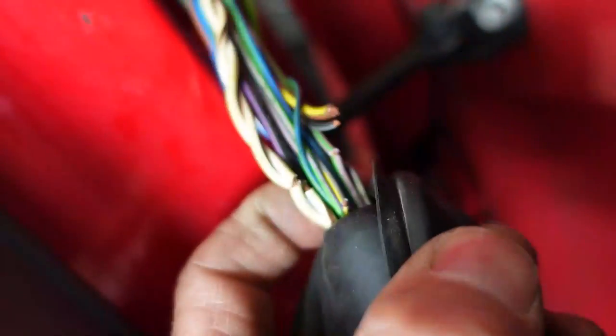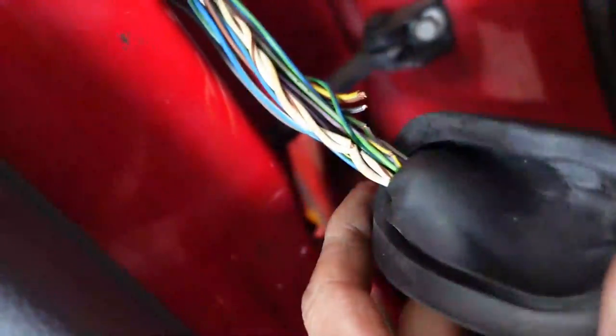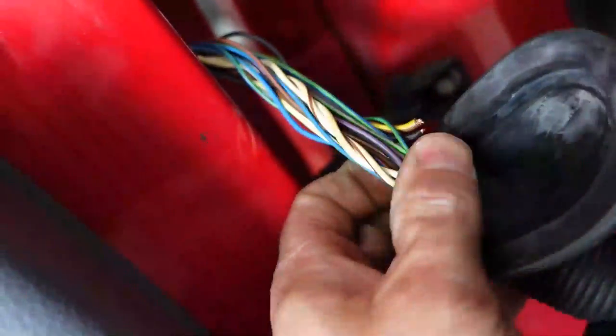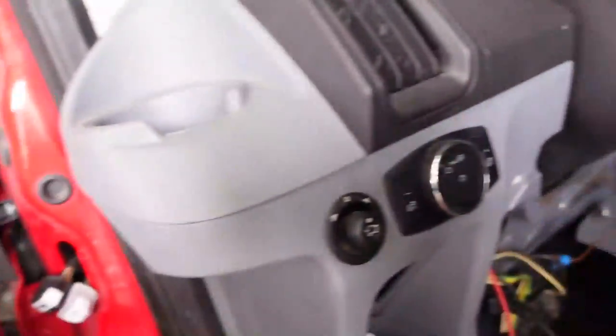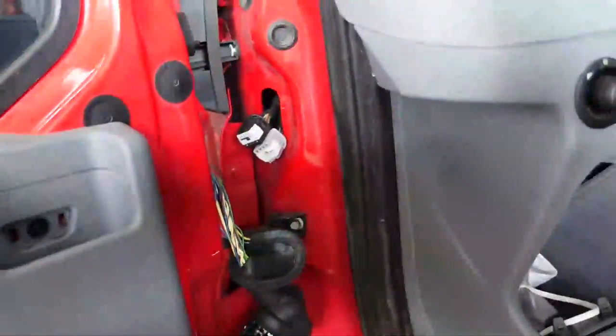We have some broken and compromised wires here in this door. So this is gonna have to get repaired. I'm just gonna see if I can sell them a whole harness. I don't think they have a problem paying whatever the price is, but I think we should probably check other doors on this as well to make sure nothing else is going on. But this is getting to be really interesting. We're about to get a BCM on this thing. I might even program the BCM with this unplugged and not plug it back in until we have this completely repaired, and then we'll see what happens.